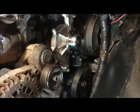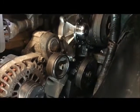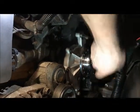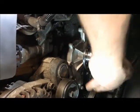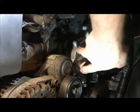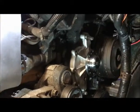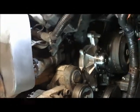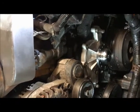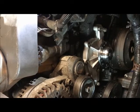The pump is on. Try to tighten the bolts by hand, all around evenly, then use the opposite order — from here to there. The 13mm bolts and the 10mm bolts, three on top and one at the bottom, all together before final torque. Always torque in the opposite pattern — that's good for not cracking anything. I don't know the exact torque spec, I do it by feel the same way I took it out. If you have a book to find the torque spec, go ahead and use it.